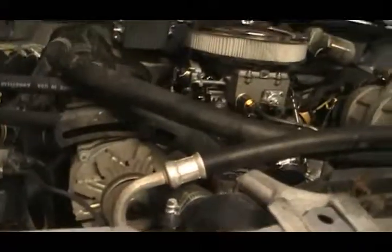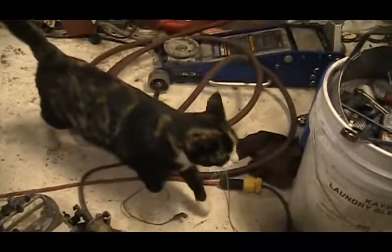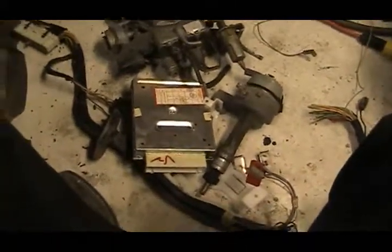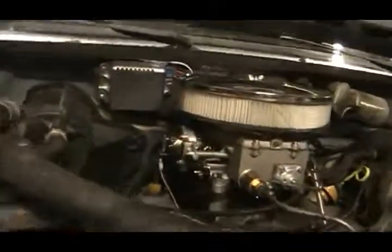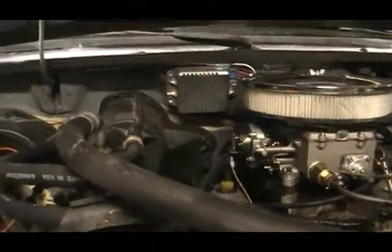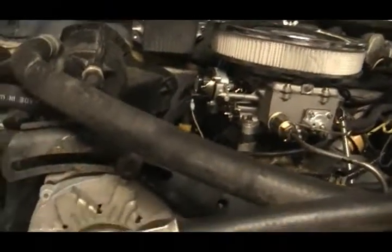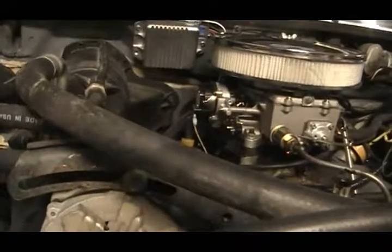In the previous video, we went through the head and did all the valve adjustment and everything, and I've got everything running. Basically, all this is converted back to a '77 Bobcat setup — the DuraSpark and the regular 2.8 distributor, and your two barrel carburetor. Pretty much everything right there is just all you need: spark and fuel. And I had good compression — 125.